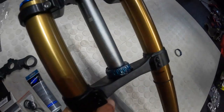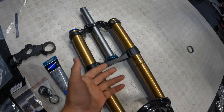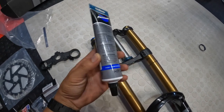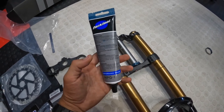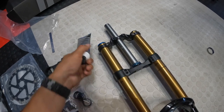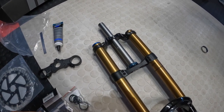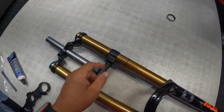They stuffed it with grease, as you can see. You can almost not even over-grease these — the more grease the better. The grease I used was this really popular high-performance grease from Park Tool. It's a mountain bike company, really well known. All the mountain bike guys love this grease, and it's waterproof. You want to throw some waterproof stuff on there, otherwise your bearings will get all rusted and won't move freely. You definitely want to hit it with waterproof grease.